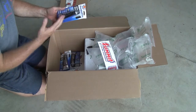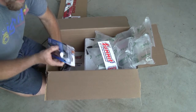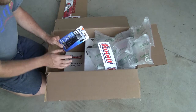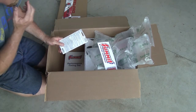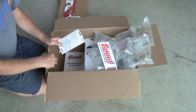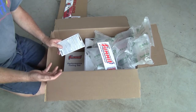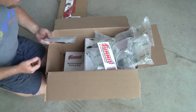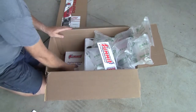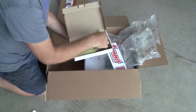I've got a bunch of black RTV, so this will definitely fix me up. By the way, I work for a silicone company during the day — and I want you to know that unless it says specifically on the label that it's not to be used in constant contact with oil, most of these will work on just about anything. The color differences are really a mental thing — blue for water, black for oil — but frankly this will work on just about everything.